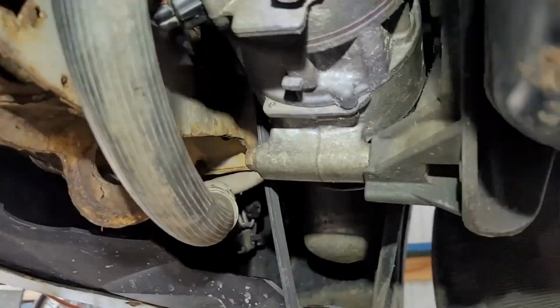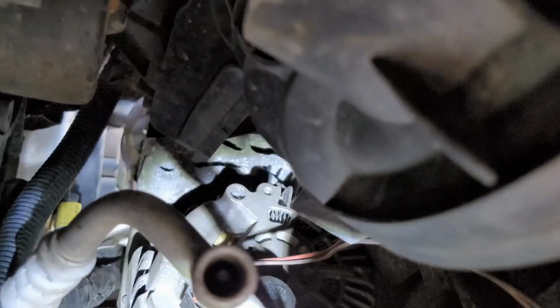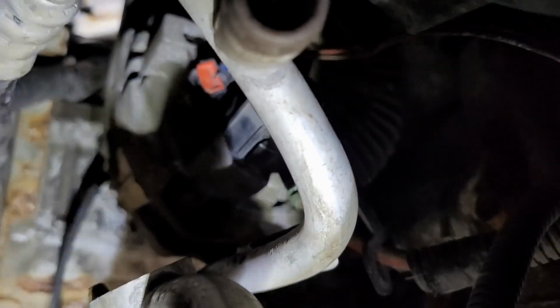All right, back together again. Make sure you got a cannon plug here. Of course you got your plugs for your alternator. Let's see if I push that thing back and lock it. Yep. All right, there's a little locking device. You can see that red thing. So you'll pop that back and then squeeze it, pull it off. A 13 nut holds your battery cable on there.